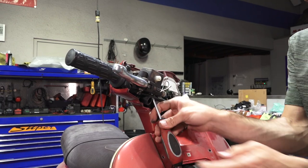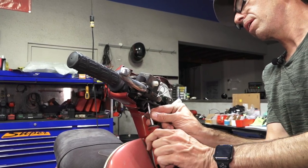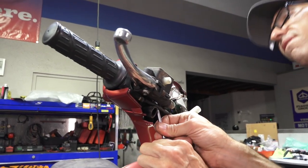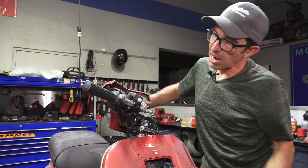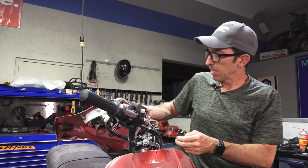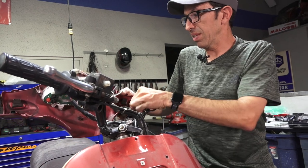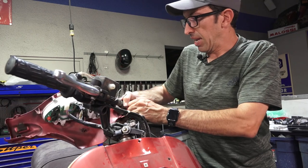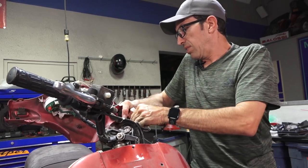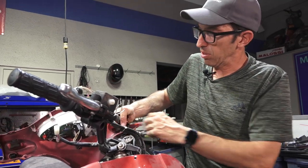Further down the road I'm also going to replace all the switches in here — that's a common problem. If you saw part two, when I put the battery in, you can see switches like the horn button are not working all that well. When switches sit for about 15 years they build up oxide, or even if you have a scooter that's been out in the weather as short as five years, sometimes the switches are falling apart. You can see now we're just held up with a bunch of wiring, and all these connectors pull right out. On the right side there are two connectors you can't really mix up. On the left side you can mix them up — the headlight connector is usually a red housing and it can be mixed up with the turn signal. If you mix them up, you'll have headlight operation on the turn signal switch. I can see there's corrosion on the horn button terminals — so we'll definitely fix that.